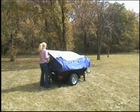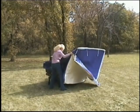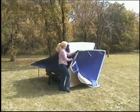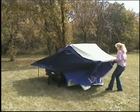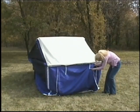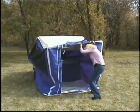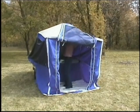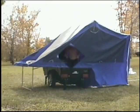Raise the forward roof bows to the right and lower the rear bedboard to the left. Extend the forward telescopic entrance bow by pulling outward and evenly on both corners. Then simply step in and push upward on the vinyl roofing material to release weight from the top peak bow, and at the same time push upward on the peak bow to its final snap position.